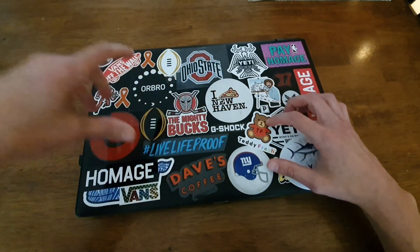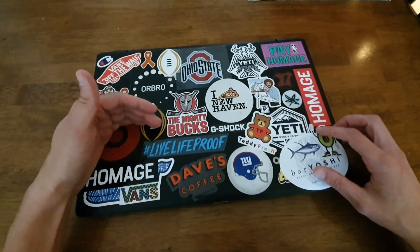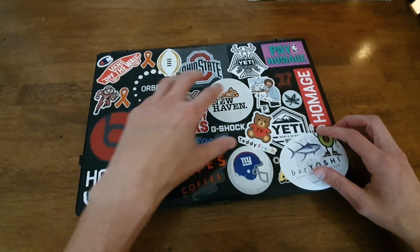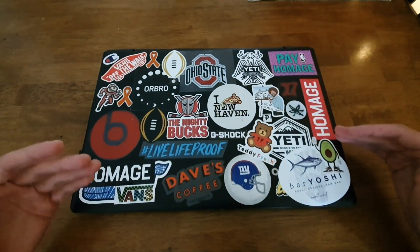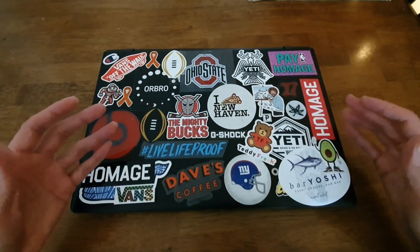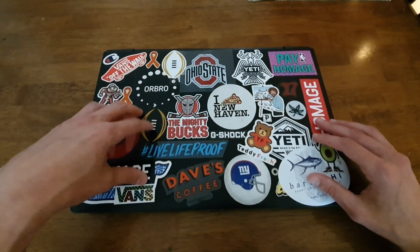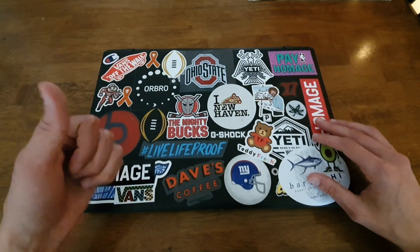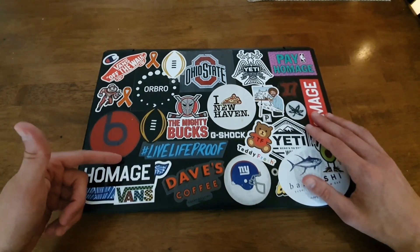Upgrade number one will be an SSD. Inside there's a one-terabyte mechanical hard drive that's going to slow things up considerably, especially on startups. The first thing I'm going to do is clone that one-terabyte drive to an SSD. Looking online, they're super cheap — Amazon has a Team Group 240GB for about 15 bucks. He's only got about 50 gigs used, so we can transfer it over to the smaller SSD.